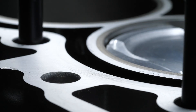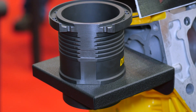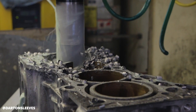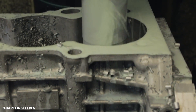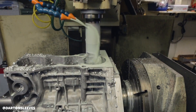What we do is make what we call our MID sleeve. It's a lot thicker and creates a removable option and a closed deck option for the sleeve. We eliminate the stock freestanding wall of the casting and replace it with a ductile iron sleeve. That makes the block more rigid and actually closes and gives the block complete support up at the top, so you don't have sleeve walk or head gasket issues with high boost applications.